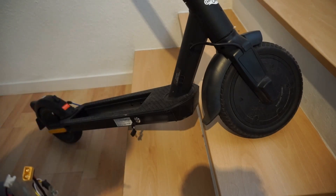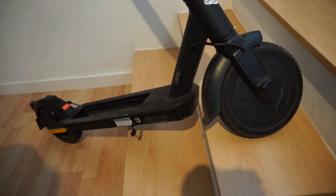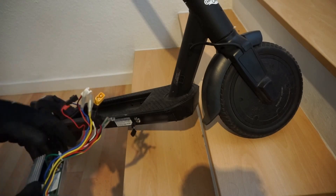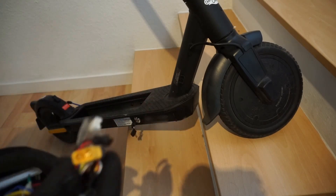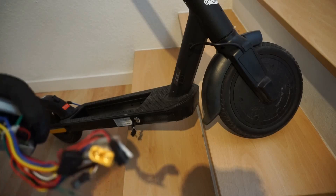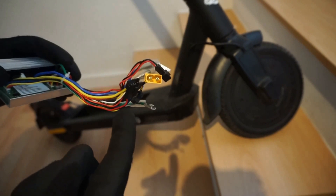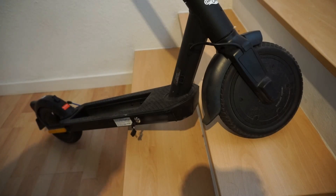That's the old controller out. Now take your new replacement controller which enables a higher top speed — I'll put a link in the description. Once you slot in the new controller, technically you're ready to go. You do everything in reverse: simply reconnect all the pins. Be sure to take photographs of all the parts as you go along, because it's very easy to get confused when putting it back together, especially if you don't do it all in one sitting.